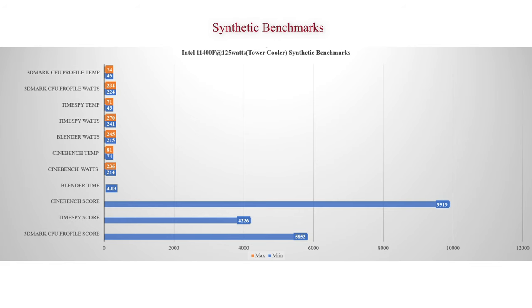On the synthetic benchmarks, the CPU temperature at max speed has come down about 18°C or more — a massive difference over the Intel cooler. We're no longer getting up to 100°C, which is great. No more worries about blowing your CPU up. The scores haven't really changed at all — Time Spy and the CPU version changed by only a couple of hundred points. Cinebench and Blender showed really no change, considering it was at maximum power before but getting over temperature.